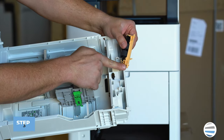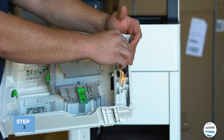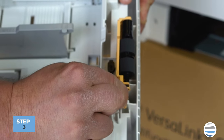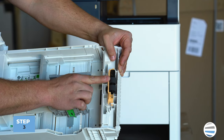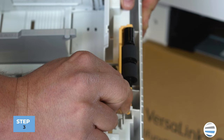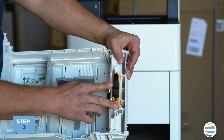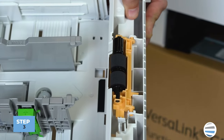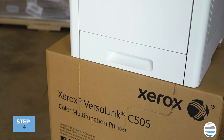To put it back together, insert the right dowel into the tray, stand it up, then lay the left dowel into its slot on the tray and slide the whole assembly to the left. Roll it back down, give it a good push, and it will latch back in place. Put the tray back into the machine and you're good to go.